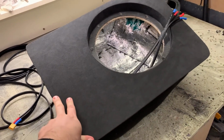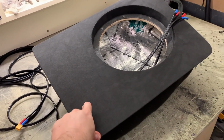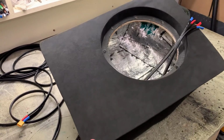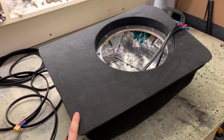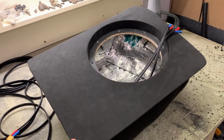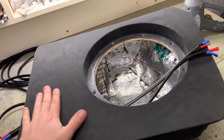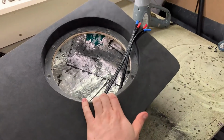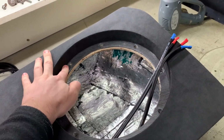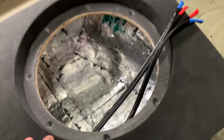I used Alcantara because we have the same material on the A pillar and the C panels, and this is the only color that's closest to the OEM color in the car. I mean, the carpet. But the floor mat is going to be above it, and hardly anything is going to be seen from the enclosure, but where it's seen, we don't want it to pop. And it gives it quite a luxurious look. I added closed-cell foam as a gasket when the subwoofer is bolted in with the machine bolts.